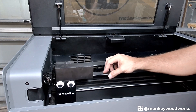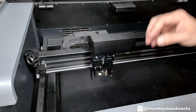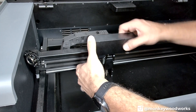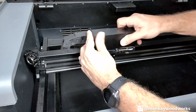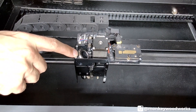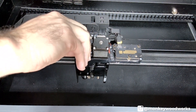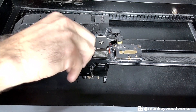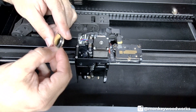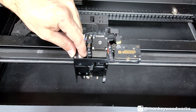The third and final mirror is actually underneath this cover. First pull this plate off — it's just held on by magnets. Then lift this whole cover up, which is also held on by magnets; just wiggle it and it'll come off. Up here at the top is where you find your third and final mirror. Take it out the exact same way — put your thumb in the little groove, pull it away from the magnets. Clean it just like the other mirrors, then gently slide it back in place and wiggle it to make sure it's seated properly.